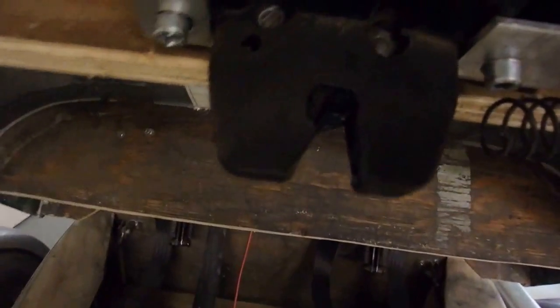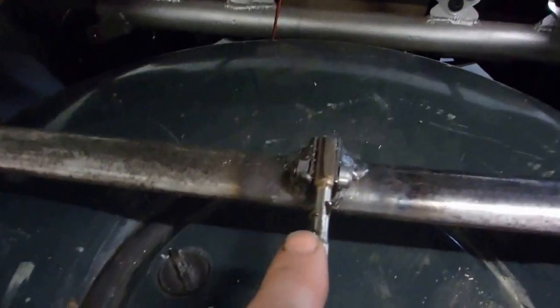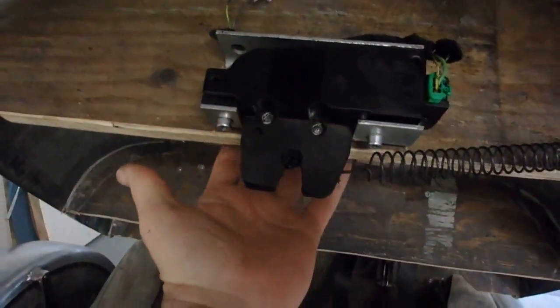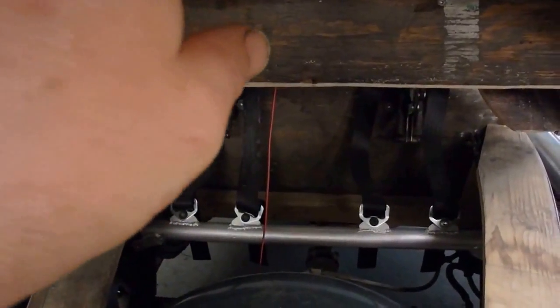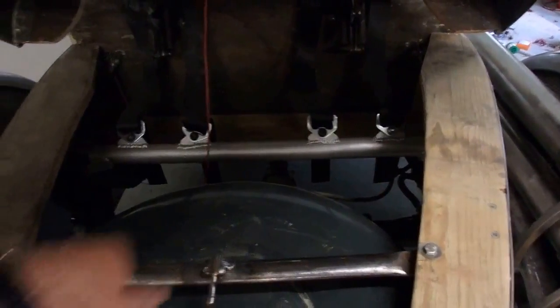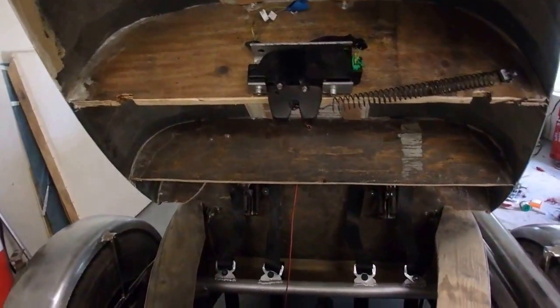So the little peg pops into this slot here. There's a little peg I made on the lathe. Fair enough, you might say. Well, originally I had it so the peg pointed that way, and this was all tucked away nicely on the back here. The problem with that was, as the lid swung down, these points here caught either side of this before they got past it. So I turned it all around. Unfortunately, totally fluke-tastically, it's all central still.